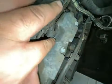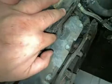I'm going to bring the camera over here — I don't know if you'll be able to hear that hissing sound. It's going to be coming from this component right here. As you can see, that valve cover is deteriorated. There's basically a vacuum leak that has been created right there at that connection point for that vent line, and it's just sucking in air because of that valve cover failure.